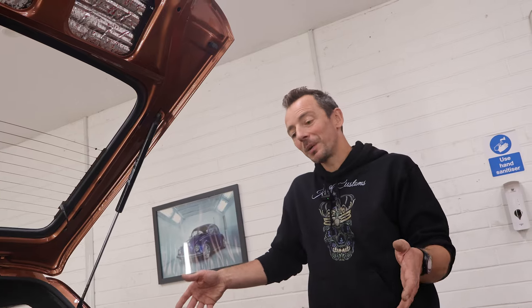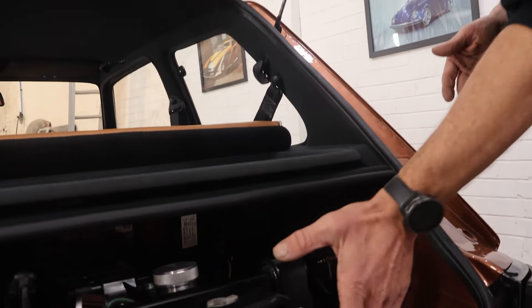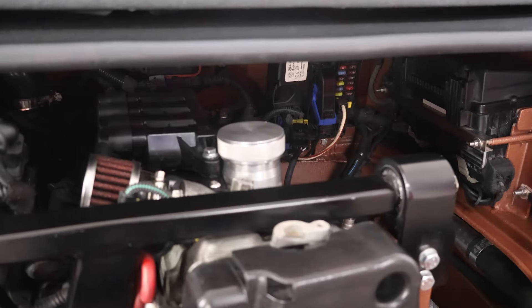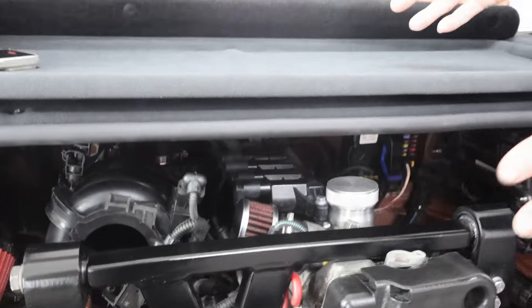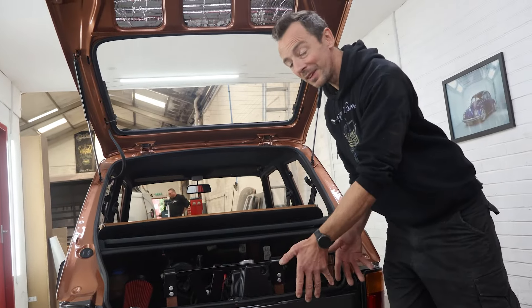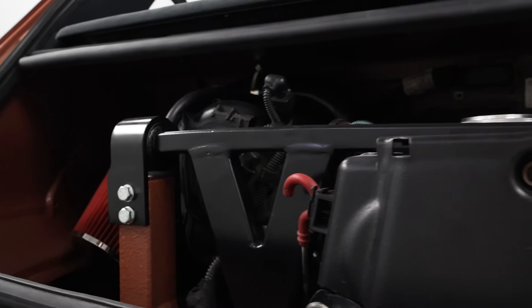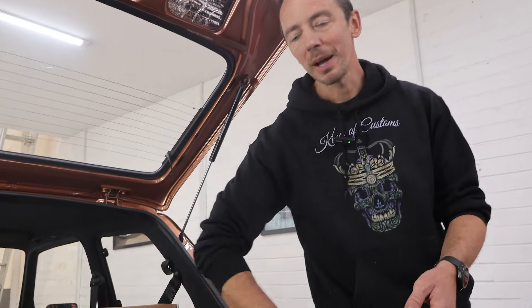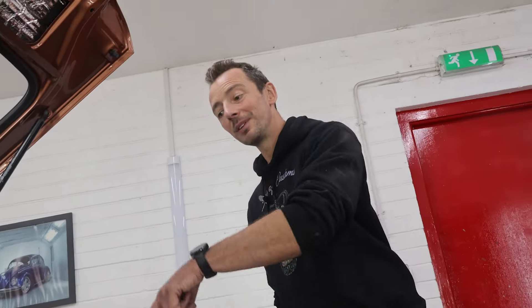We could never have known the amount of work this was going to take — it's been an absolutely crazy amount, mainly because we wanted it to look nice. Not only is it a lot of work to get the engine out of the Punto and into this, because it's not meant to be in there — yes, we bought an adapter plate, engine mounts, and things like that — but they all needed modifying to fit in this 126 BIS model. As standard the engine sits out about this far, meaning we would have had to box all the back around the engine and the bumper wouldn't have fitted. So what we did was move the gearbox forward, bringing the engine forward and keeping everything tightly tucked inside the standard engine bay. So you can still shut the boot, nothing on the back looks different from standard — it really is a bit of a sleeper.